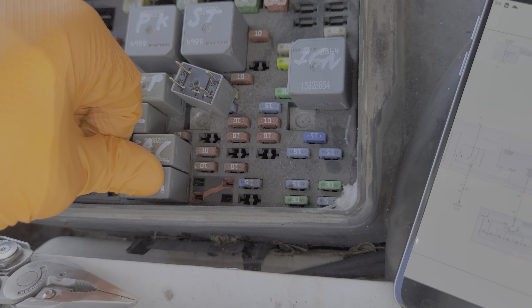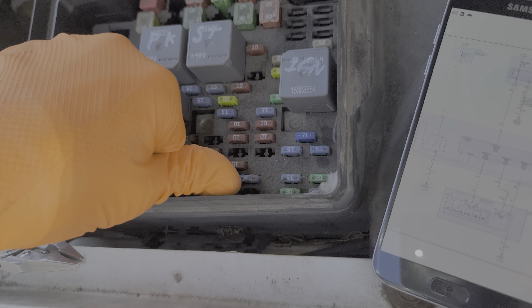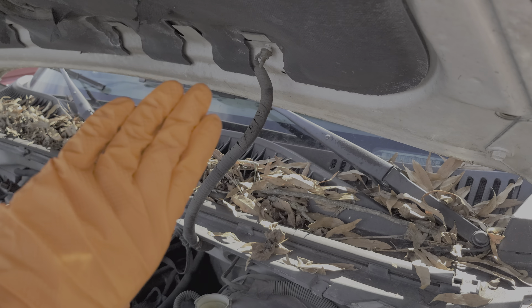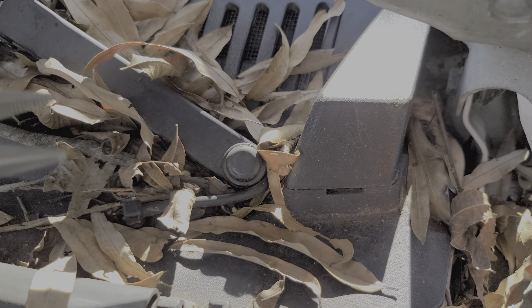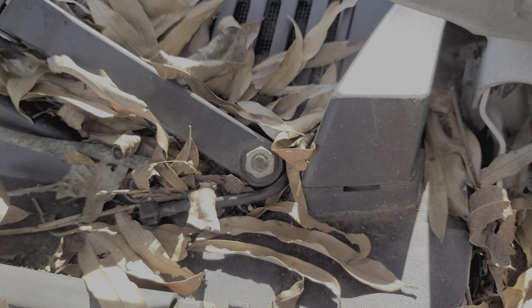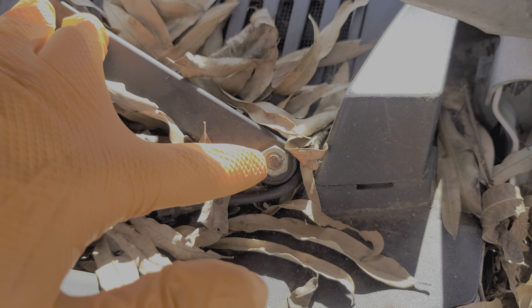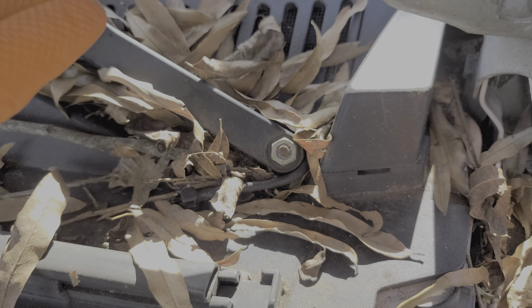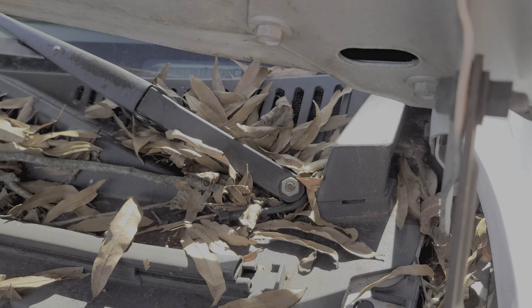That's a troubleshooting step to see if the washer motor is able to work when you directly send it power. Now if the wipers are not working, or if one of the arms is moving and the other is not, what I like to do is pop this cap off and check to see if this nut is tight. Sometimes the nut will get loose over time or the wiper arm will strip — if there's a lot of ice that builds up on the wipers and you turn them on, that's what can happen.